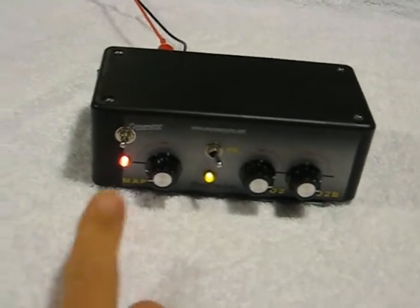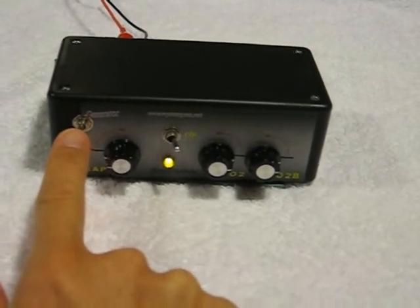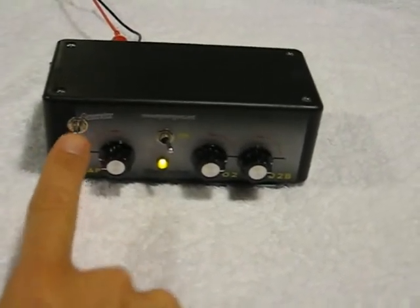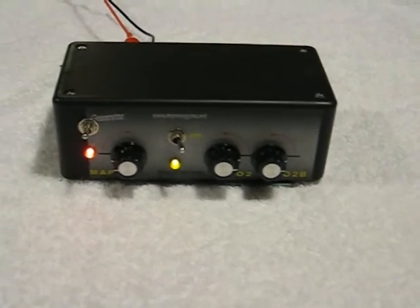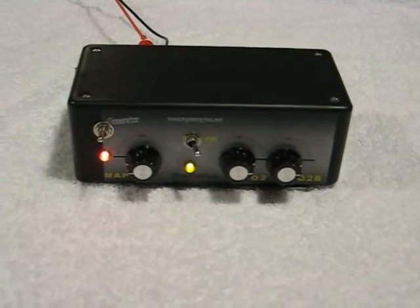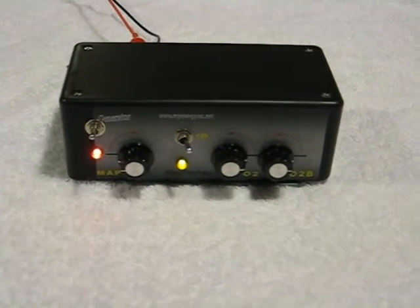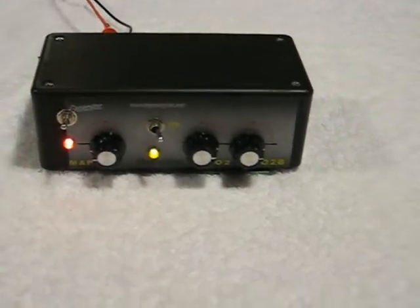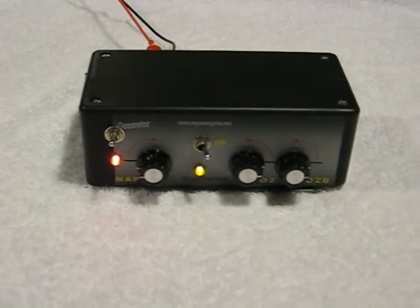The best thing to do is to hook up a switch. The switch is wired to a relay with very low current running through the box. The switch closes the relay, and then the relay sends the high current to your generator. That's a very safe way to do it. You can even wire the switch through a switched circuit in the vehicle so it can only turn on when the vehicle is on.